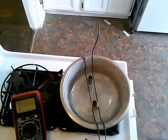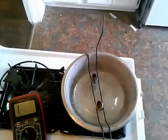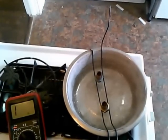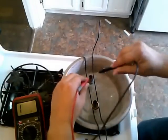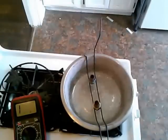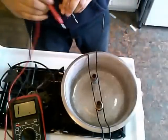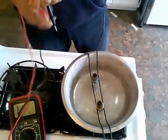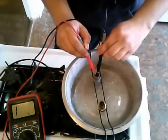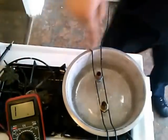So this is about ready to be tested. I'm getting about 100 ohms on the new switch. I'm going to go ahead and test the old one — and the old one doesn't give me any readings at all, so that one's broken. I'll try again. Yeah, so the old thermal switch is broken.